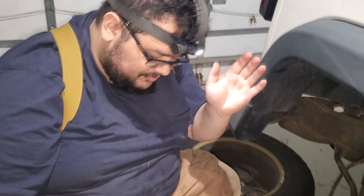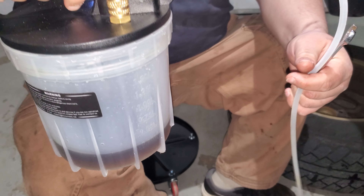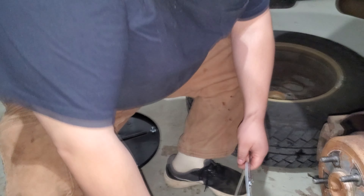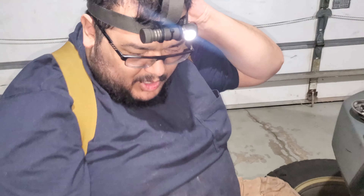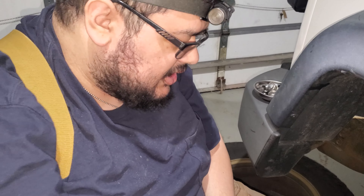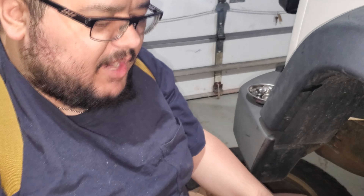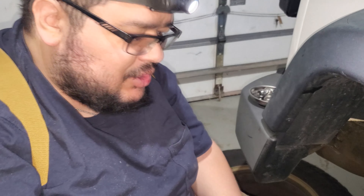If you look at the line, you'll see the brake fluid is actually coming through clean — we are pulling clean brake fluid through now. And if you look at the actual bucket, this is what we started with, and this is what we're pulling through right now, so we've definitely got clean fluid coming through. As far as the air bubbles are concerned, I'm wondering if the tool doesn't have a perfect seal. But if that's the case, we just need to tighten the nipple before we pull off the connection.